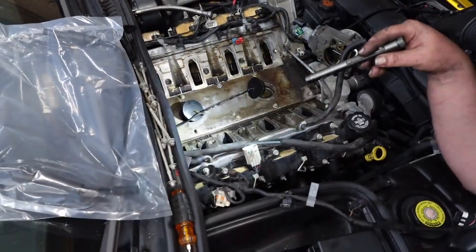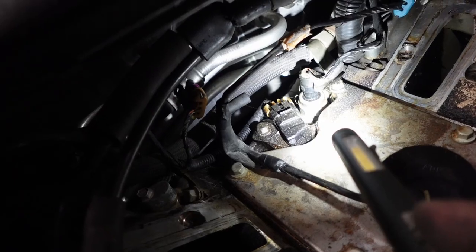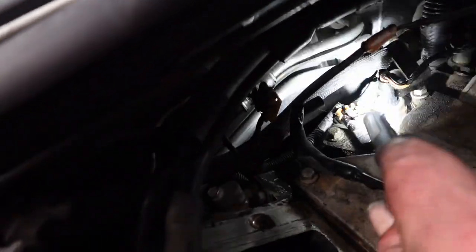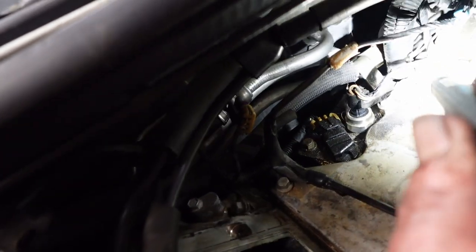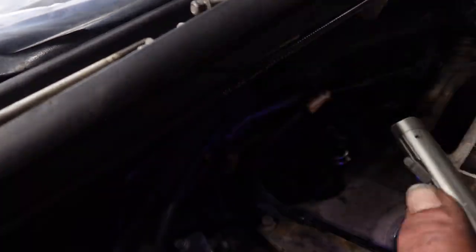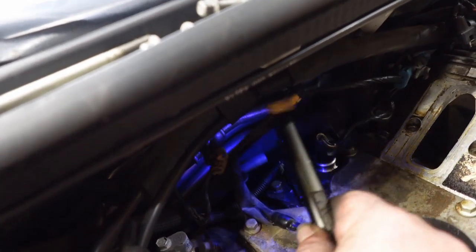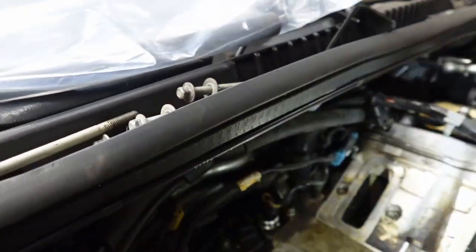She's actually pretty clean. Obviously, hold on, let me rotate stuff around. Oily mess, but that pressure sender right here looks like it's been replaced. The cam sensor looks original, but you can see it's all fresh-ish looking oil. I did throw my UV on. This one does have it, and nothing out of the normal picked up, even if it glows in this, so I think it is a rear main issue.